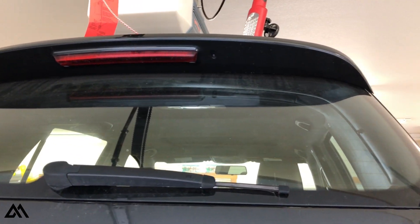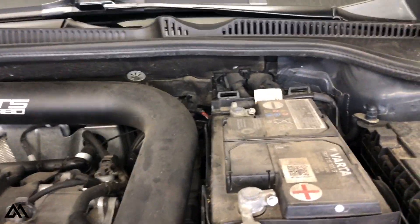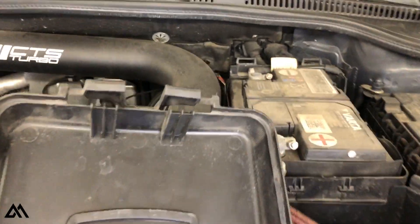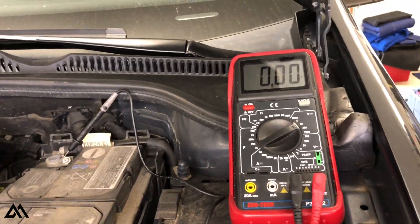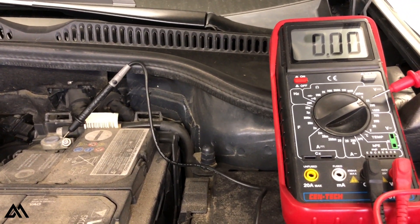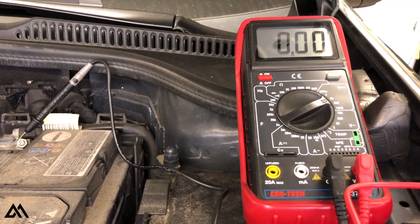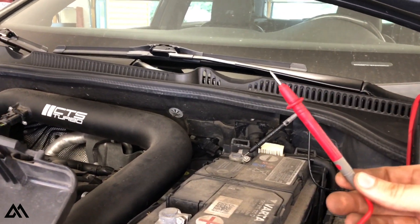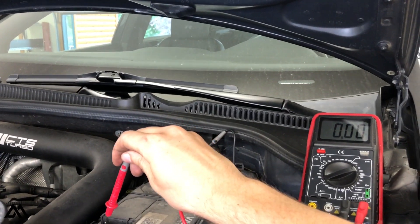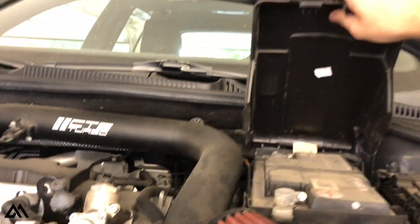The rear washer nozzle is right here and since I drive the car every day I know it's working properly. To check the battery, push this tab in and you can see the battery — visually inspect it for corrosion. You can put a voltage meter on it to test the voltage. I've got the multimeter set for volts at the 20-volt range. Ideally we're going to be around 12 volts. With the ground probe on the negative terminal and the positive probe on the positive terminal, our reading is 12.32 volts.